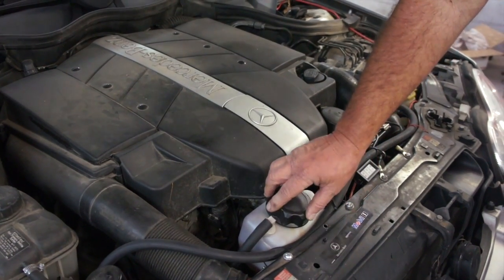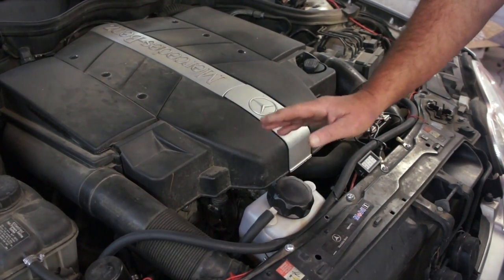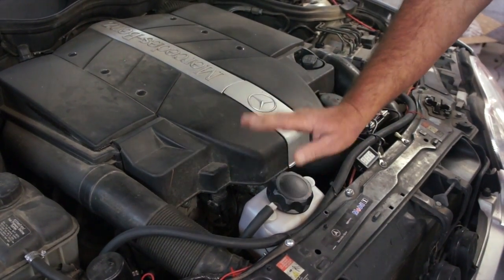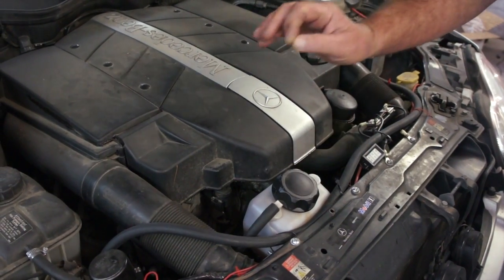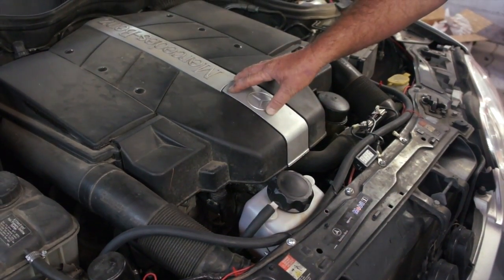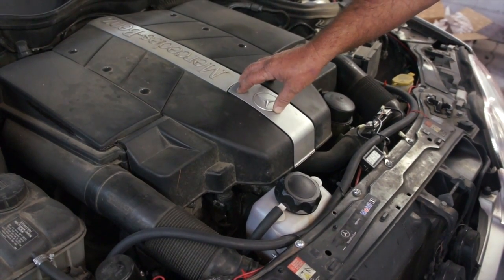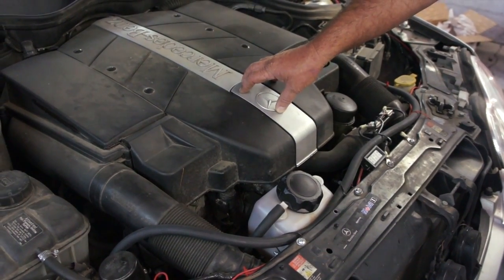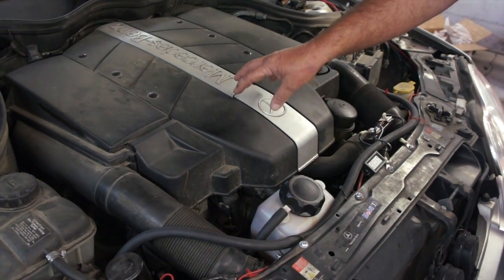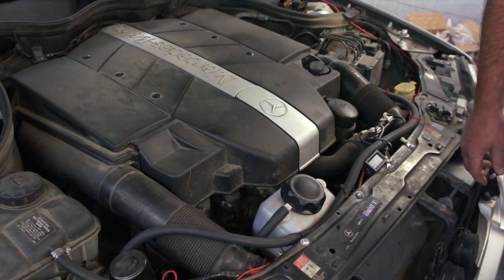Simply put distilled water in here with a very small bit of the electrolyte — the potassium hydroxide that comes with the kit. Start with your amps very low, about two, two and a half at the most. Then work your way up every hundred miles or so until you find that sweet spot where your system is making just the right amount of hydrogen for this vehicle. A lot of people will make the mistake of adding way too much, making the amps way too high, and then your mileage will actually decrease from before you even put the system on your car. A little bit at a time, because the hydrogen will act as a catalyst for the lesser amount of fuel going into the car to burn at 100%. Thank you for watching.